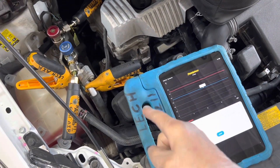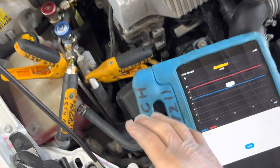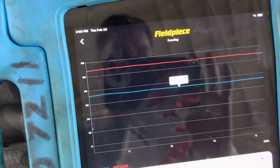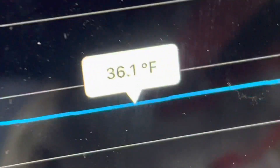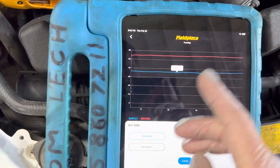Air conditioning on this 2014 Prius. After finishing the charge, we're blowing a steady 36 degrees out of the dash — 36 degrees constantly all across. As you can see, by the time I'm already into the 11th, 12th, 13th, 14th minute, we're coming up on minute 15 and it's just rock steady at 36 degrees dash temperature.